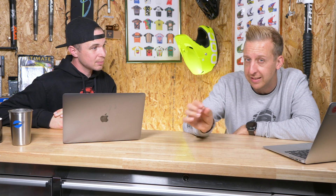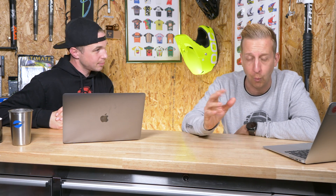Even if the frame were strong enough, it's not going to ride that well — you're going to bump up the bottom bracket. It's easy to say don't do it, but when people want to change the way their bike is, it can be a can of worms. If you want to make the bike more capable, there are other ways: get your existing suspension tuned, or extended slightly — 10 or 20mm, not a massive amount. But if you're that desperate for a Lyric or a Super Deluxe Coil, it's really the wrong bike. Maybe consider spending that money on a new frame and fork option instead.